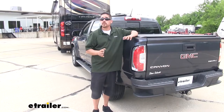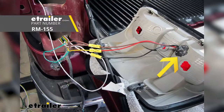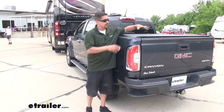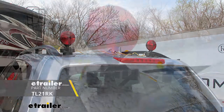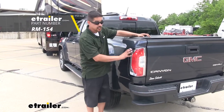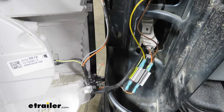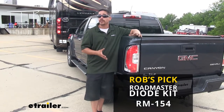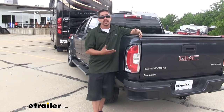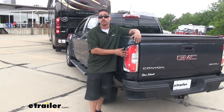As far as wiring goes, there are three basic types available. The bulb and socket kit uses a separate bulb that we mount inside our tail light housing. The magnetic light kit is a separate light we mount somewhere on our Canyon and run a wire from the front to the back of our motorhome. And finally we have the diode kit, which doesn't change the outward appearance of our truck at all — we splice in and use our factory lights to transfer those signals. I recommend the Roadmaster high power diode wiring kit because we can see that it works, it's a permanent installation, and it's a lot easier to repair a wire than to repair a tail light housing if you misdrill the hole for the bulb and socket.